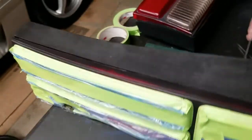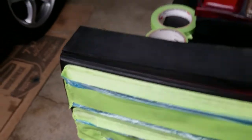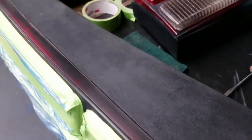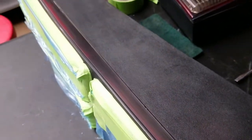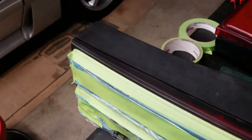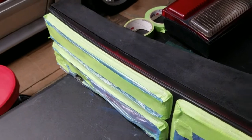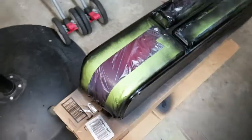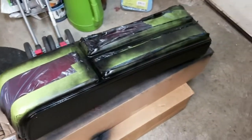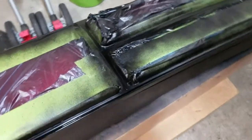Getting down inside the crevices can be a little tedious, but if you want your paint job to look good you've got to make sure you sand properly. I'll hit it one more time before cleaning it with some denatured alcohol, then apply some adhesion promoter. Just kind of dusted the first coat over to make sure everything was going to stick — looks like it's sticking pretty good, nothing's bubbling up.